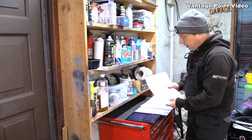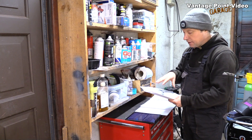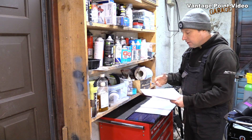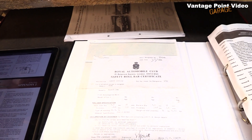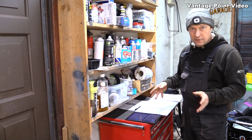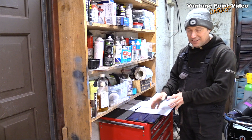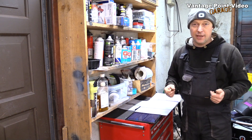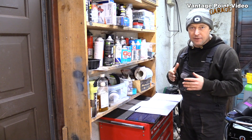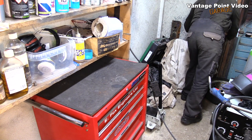Just one more thing in relation to the homologation papers. I've noticed that later ones have details of the homologated cages for the car in them, but in 1980 it doesn't seem like they had that, at least for the Cadet anyway. So what I have is a homologation paper just for my cage, stating that it's for a 1980 Cadet. That's what allows me to work within these regulations from the time — that cage complied with Appendix J 1980. If you were to build a new cage now for the car, there are different regulations in relation to that. But this is for working with a homologated and certified cage. With all that fresh in my mind, I could get my steel and prepare to start cutting.